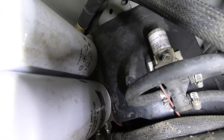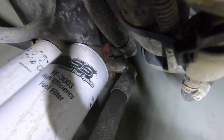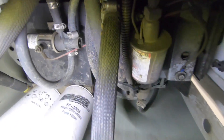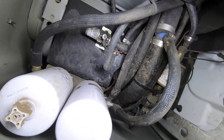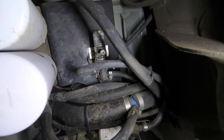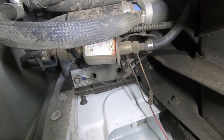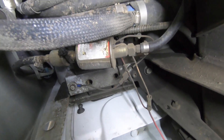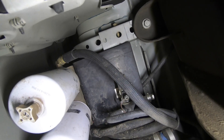You can kind of see it right there. It's kind of nice too because you can mount other things on the bracket. This is the fuel selector valve I have mounted for my auxiliary tank. And this is the fuel pump I've mounted for my auxiliary tank also. I just zip-tied that right there, but that's how I pretty much mounted mine, guys. It's a lot cleaner — it's not hanging down. It's a much cleaner look.